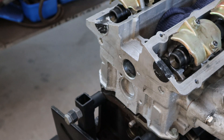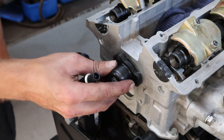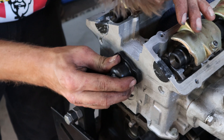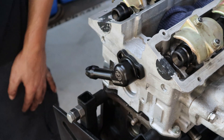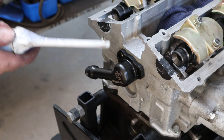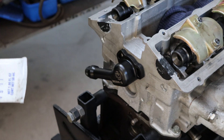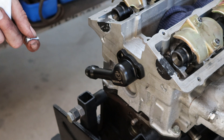Alrighty, so the scary part's done. Time to fit the fitting. It's a rubber O-ring seal against where the Welsh plug seats. So, as always, a little bit of rubber grease for the O-ring seal — a bit of rubber grease on the seal helps it just seal up. The other thing you've got to consider when you're doing this modification as well is now you've got two new bolt holes that go through to a wet area and are no longer blind. So a little bit of thread sealant is always very good for this sort of thing, otherwise you could have potential oil leaking out the threads.